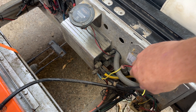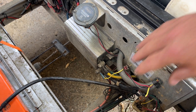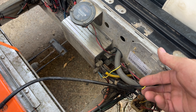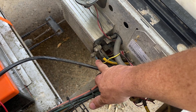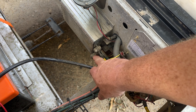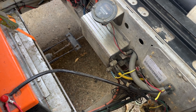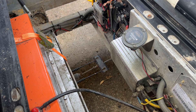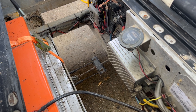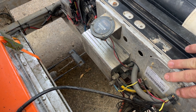Sergio, I hope you're still not having a problem — it took me a few days to get this video out. Just cut your yellow wire, terminate it with a ring terminal, and put it on your B negative. You'll find that the cart will operate smoothly just like that. This is no longer an issue.